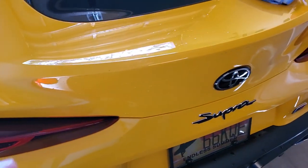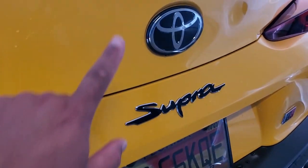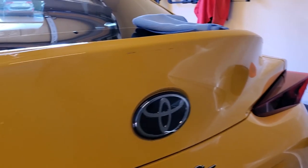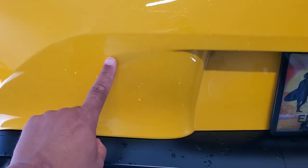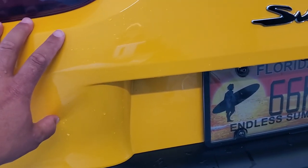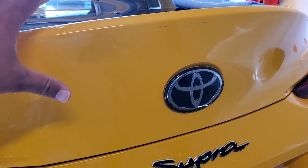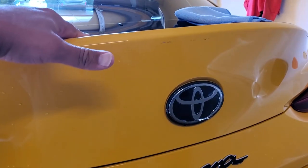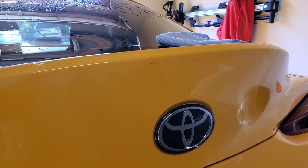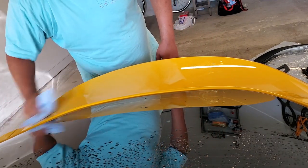Wing is off. Washed it to get rid of the contaminants and dust. Next thing I'm going to do — because I didn't want to rub on it while I had all that dust and grit — is use some safety body solvent on this little glue residue here. It's body-shop safe, won't hurt paint, and takes wax off. I'm going to clean the whole back trunk, even around the emblem. There's some little black specks, some tar wash from the road. Then I'm going to use a synthetic clay bar and clean this whole area, and polish with a buffer to make sure there's no scratches. That safety body solvent really makes the glue dissolve and come right off — no need to use an eraser wheel.